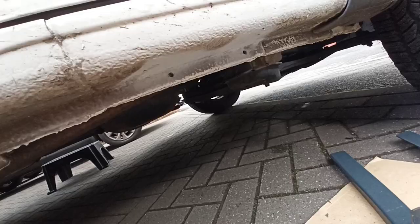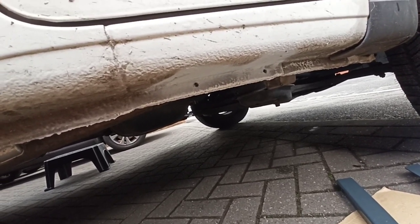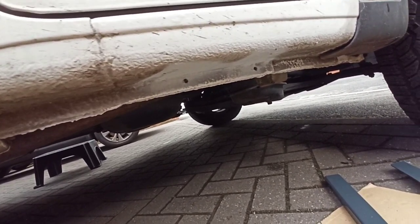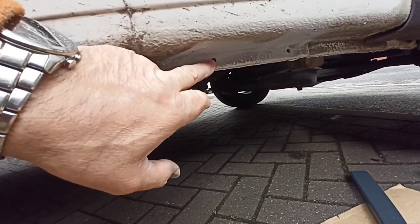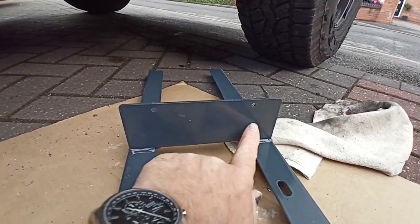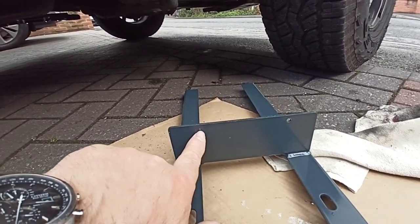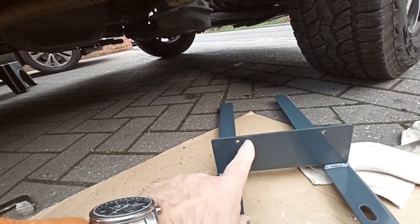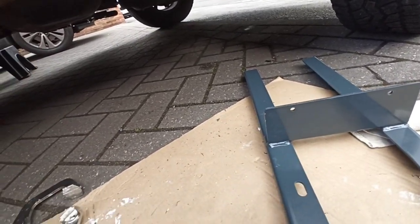That's the two holes drilled. What I've done is sprayed a small amount of edge primer into the holes and around the holes. On the bolts I'll put a little bit of PU adhesive on the bolts and washers, so when they're pressed into place it actually bonds and seals the hole. On the back of the bracket — because I'm bolting it on the inside — I'll put a line of PU adhesive along the back and a little bit along the top, so everything's sealed and water can't get behind it and into the sill.